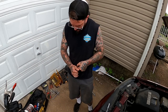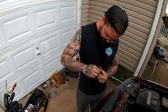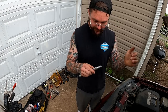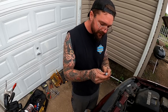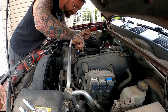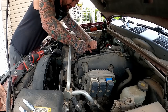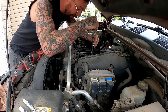These are probably pre-gapped, so you really just want to make sure the tip isn't bent. If one's bent you'll be able to tell. These things are gapped exactly like the old ones were, and we knew it was running on those — so good enough for me. The next tricky bit is getting this down in there and getting it started since the socket isn't wanting to hold the plug. You'll notice we had some electrical tape in our bag — what happens if we just shove it up in there on one side and tape it to the other side? That holds it real good.